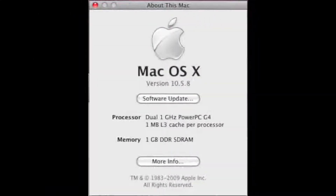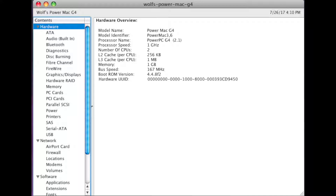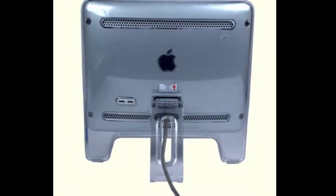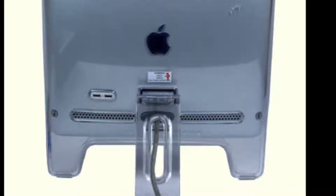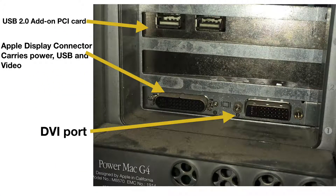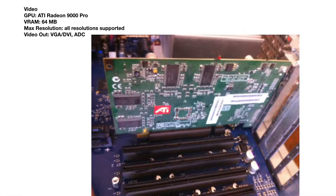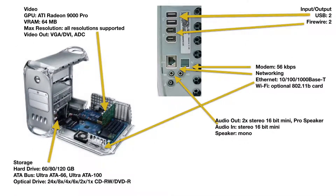The latest OS that this computer supports is Leopard, or the 10.5.8 version. I got it with one gigabyte of RAM and an ATI display card. Back then ATI was an independent company, now it belongs to AMD. The graphics card had a special connector made for Apple called the Apple Display Connector — like a primitive Thunderbolt connector — because it carried power for the monitor, two USB ports, and the video signal in just one cable. The two processors from Motorola came on a daughter card. It has four full-length PCI slots and one AGP port — back then the AGP port was for graphics.